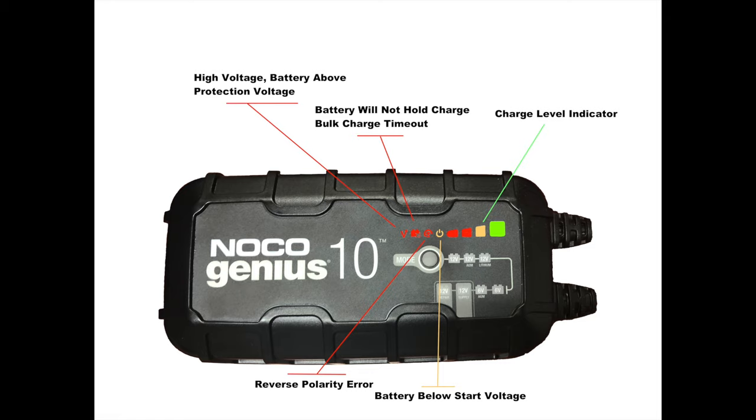The last one is the power button. If you're stuck in power mode and not able to get outside of it by hitting the mode button, that indicates your battery is below the 1-volt threshold. When that happens, hold down the mode button for 5 seconds and that'll initiate force mode, which turns the charger on regardless of battery voltage for 5 minutes, putting about 10 amps in to artificially raise the voltage so you can select a 12-volt or 6-volt setting. The temperature mode — not shown in the diagram — has the first three lights blinking together in rapid succession to let you know the temperature inside the charger or the ambient temperature is too high or too low.